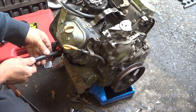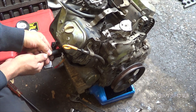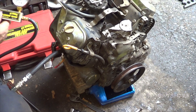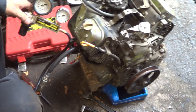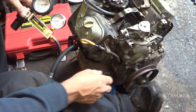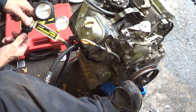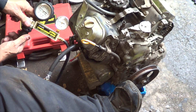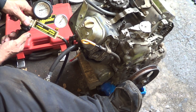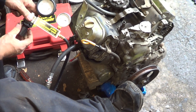I want to get this thing running, but I'm not sure if it will be running today, because I might end up taking the carburetor — I like to wash it before I put it in an engine, but I want to make sure it's good. Now I got this Harbor Freight compression gauge and I had to make some adjustments because their gauges are crap — you can't even see it. I've got this up on top dead center. You're going to have to stop the flywheel and turn it. I don't know if I can do that with my foot. We're going to run this up until we get to 70 pounds or so. I'm coming out the carburetor — I'm on the wrong stroke where the valve is wide open.